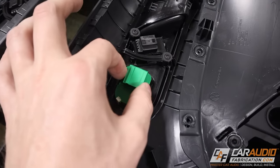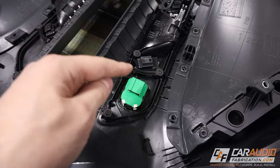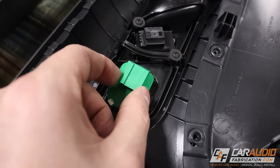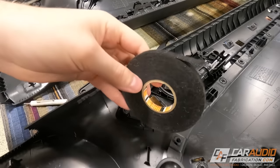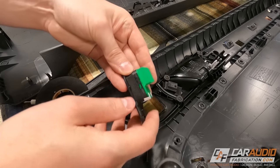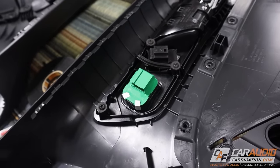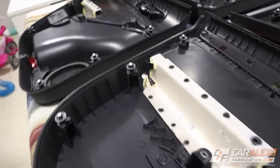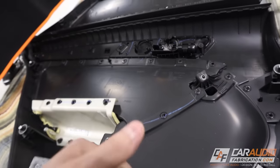Once you've addressed the clips, the next thing you want to look for are the little electronic modules. These are usually designed in a way that they can be removed from the door, but because of that there's a slight amount of play that can rattle. So I'll pop the module out, wrap a very tiny amount of cloth tape around it, and pop it back in. With that very small modification it no longer rattles. Luckily on the rest of these doors the others don't seem to be an issue, and one door doesn't even have anything electrical attached to it at all, so we look good to go.